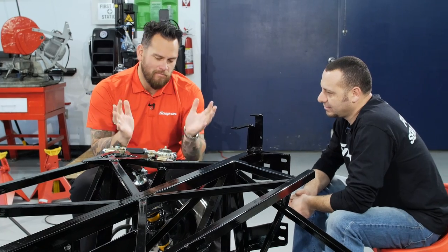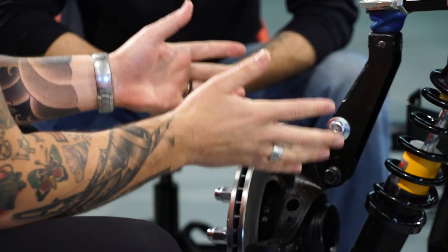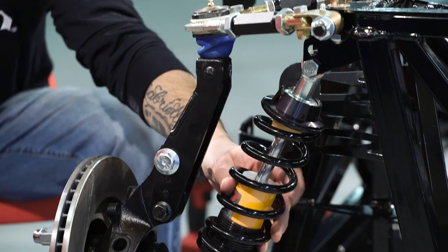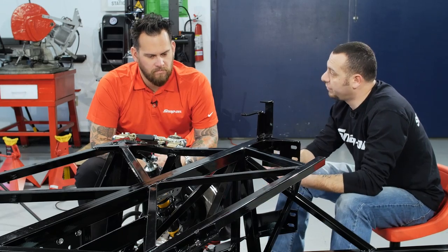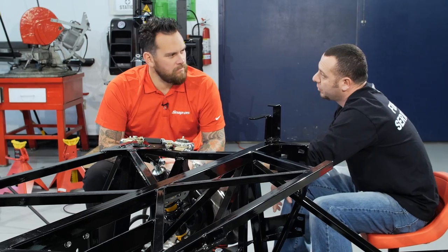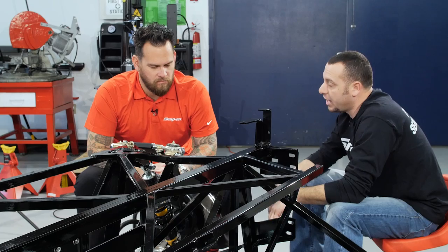With the corner of the vehicle on the chassis and torqued down to the right specs, the front suspension combines donor and upgrade parts. The kit includes a double-adjustable coilover suited for the weight of the car. The lower control arm and spindle come from the WRX donor, while Factory 5 provides the upper spindle adapter and fully adjustable upper control arm, allowing a lot of the donor car to be reused on a killer chassis.